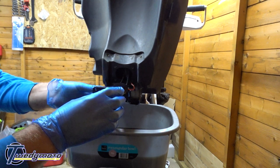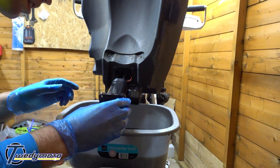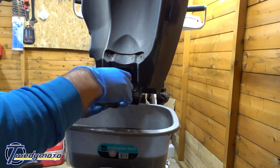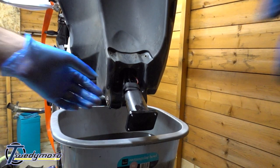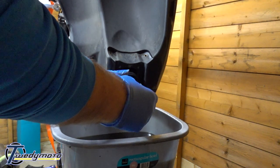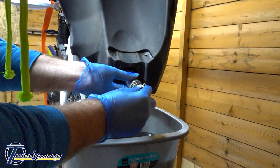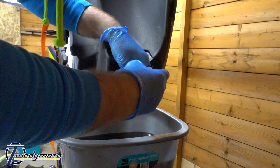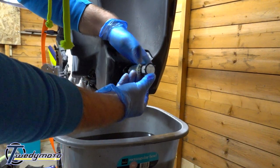One of the fuel filters is in here - it's the pre-pump filter. To get at it there are two clips on either side; press them in and it pops off. The manual just says pull. So that little one just pops off and snaps back on. Get the new one on - just lube it up with a bit of petrol and that'll be fine.